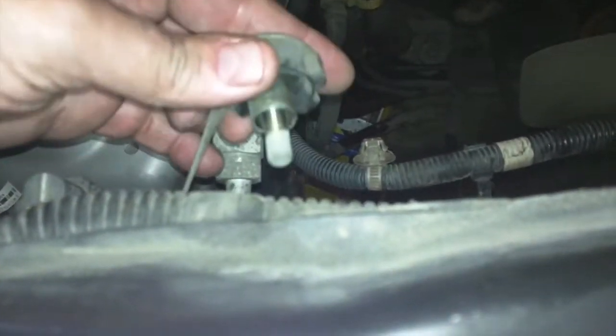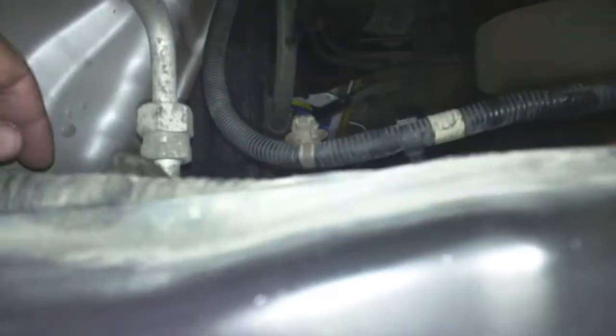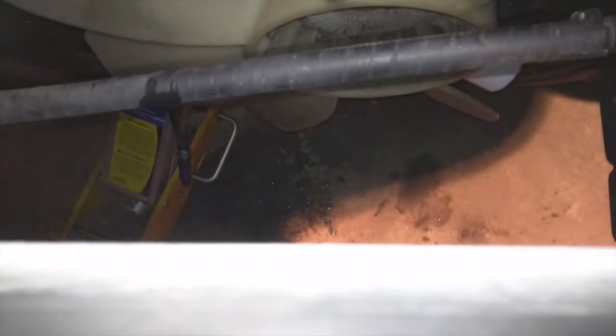I mean, there was a couple little points where stuff like this got hung up on the radiator. It actually goes in like this and then gets bolted from the other side. But all in all, it just came straight up and sort of created quite a bit of a mess. But just keep a good roll of paper towel around. It wasn't too bad. And a drain pan, and you should be okay. And there you can see the radiator's out.